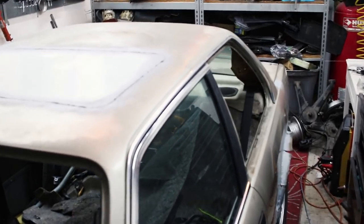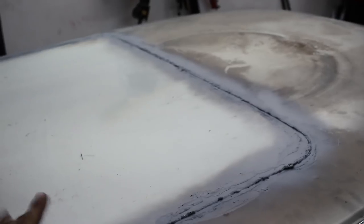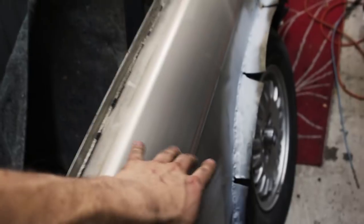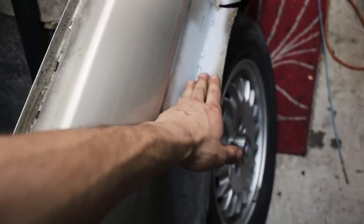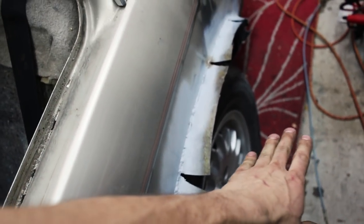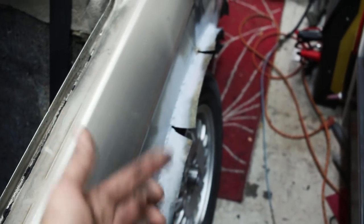So finally, after about two solid days of work, we've done pretty much all the welding that was required. Welded in the sunroof, deleted the whole cassette, welded in the rear quarters. This will all get cleaned up, squared up, and then possibly building straight, basically tubs, external tubs for under the Rocket Bunny kit, just so if rocks come up, they don't crack my kit.